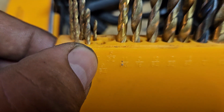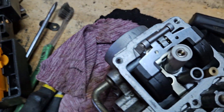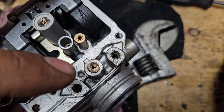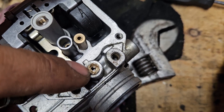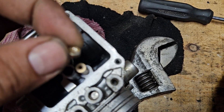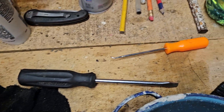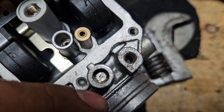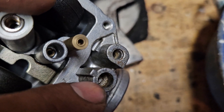I used a 5/32 or 1/8 inch drill bit, and you have to carefully cover these areas. I was cleaning everything out because my motorcycle was idling very rough and I wanted to adjust the fuel mixture screw. You have to drill out this cap and then pry it out somehow, because there's no way to grab it with a pick or anything — you have to put a screw in and pull it out. There's about an eighth of an inch of space to drill without damaging the bottom screw.